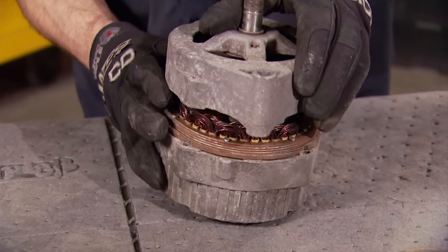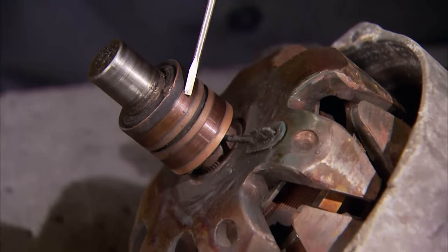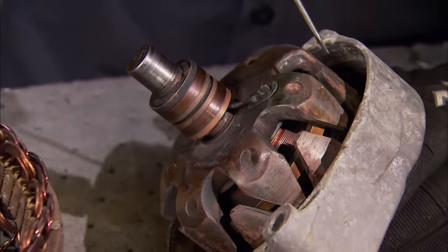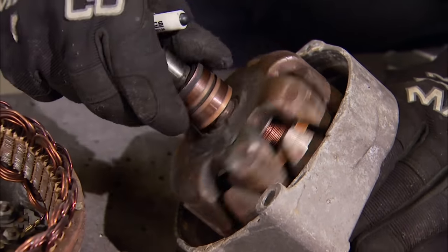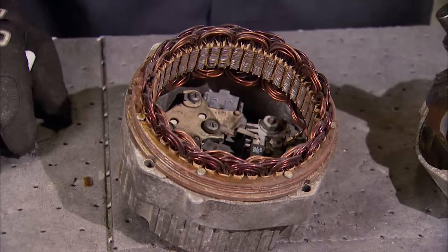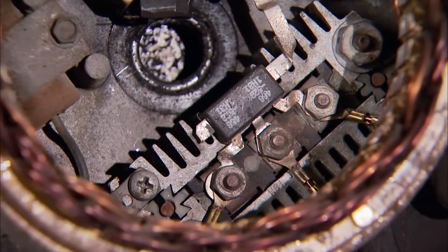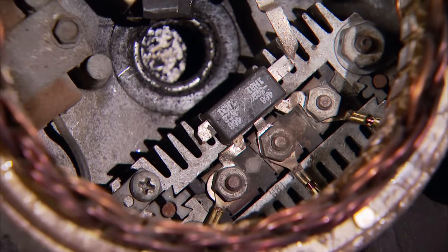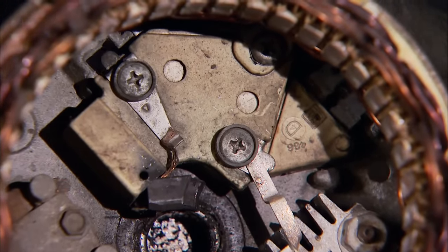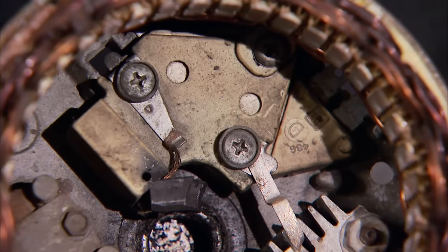An alternator obviously produces voltage, but it does require an external power source to energize it. When you turn the key on, 12 volts pass through the brushes and onto the slip rings, which transfer the power to the field coil behind the rotor halves, creating a magnetic field. Half of the rotor is a north pole effect and the other is a south pole — they alternate. As the engine fires up and the belt spins the pulley, the rotor spins inside the stator housing, creating an alternating current. But cars run on a direct current or DC system, so the voltage has to be modified. To accomplish that, they use a rectifier diode assembly — diodes are basically one-way electrical check valves, only allowing current to pass through in one direction. Once the voltage has been converted to DC, it's got to pass through the voltage regulator assembly. Without that part, there'd be no way to regulate the amount of voltage the alternator produces — the faster it spins, the more voltage it produces, and it would do damage to the rest of the electrical components on the vehicle.